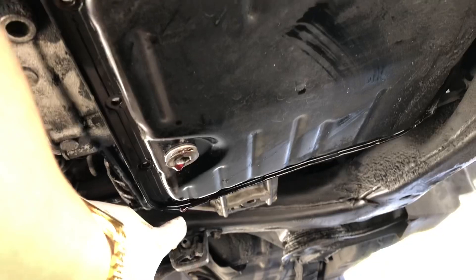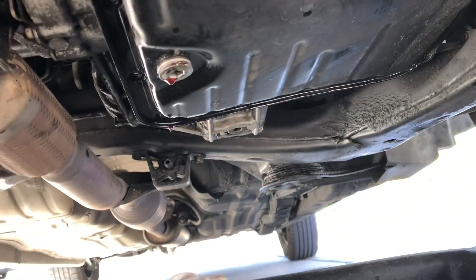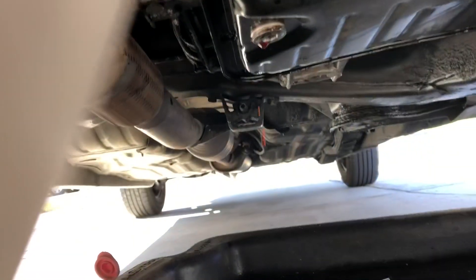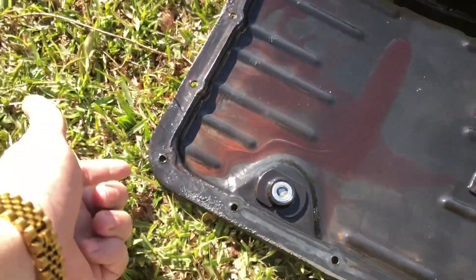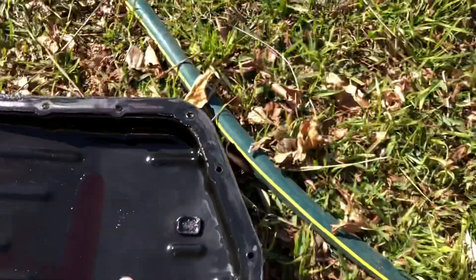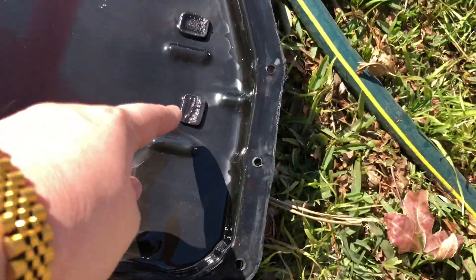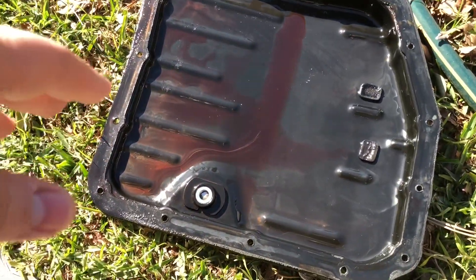Yank on the side, and then all of the fluid is going to come right back down on the oil pan — and yeah, you're good. I'm feeling like this transmission flush is kicking my ass. Now that you have the transmission oil pan out, we're going to start by lifting up the gasket, cleaning the surface, removing the drain plug bolt, cleaning the magnets, and making sure it's dry.